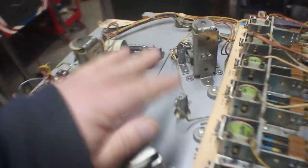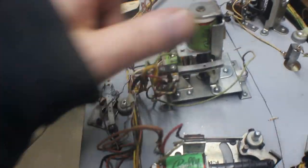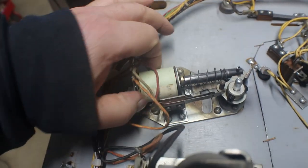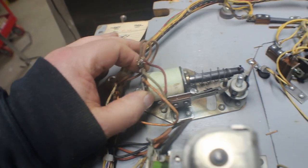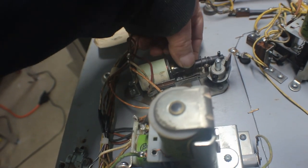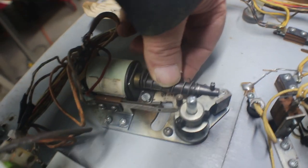We're gonna resleeve some solenoids, our pop bumpers, our kickers. We'll check our flippers and down post. Our post buttons here. This coil looks pretty good. This one, I don't know, was changed, and I don't recognize that coil whatsoever. Our flippers are actually pretty good, except I want to check out what's going on here.